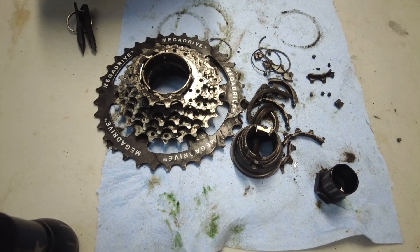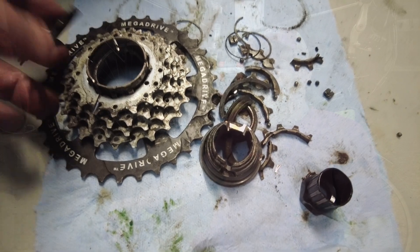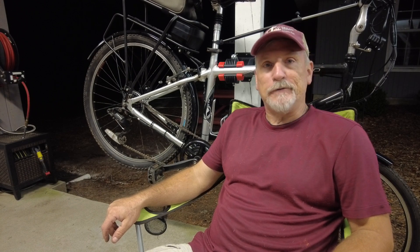Rascal, our puppy dog, wasn't in the frame very often but she kept me company all day long while I worked on this project. What should have taken just a few minutes took a few hours — thank goodness I had a grinder. This is what's left of that sprocket and it really was hard to get off, but it is done and adjusted. I can't wait to use it — now I should be able to change gears without the derailleur bogging down in the lowest gear. If you ride bikes and do your own maintenance, I hope this was helpful. Like, subscribe, check out my playlist, and I'll see you in another video.